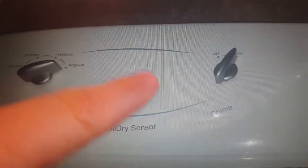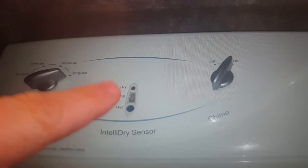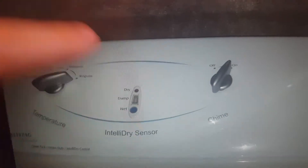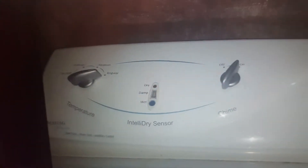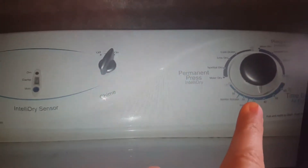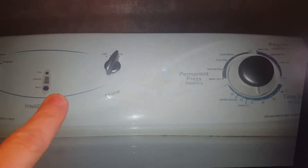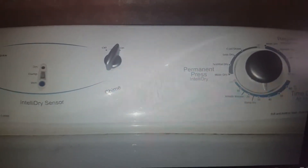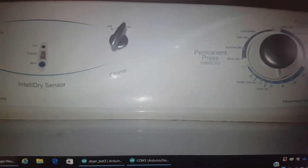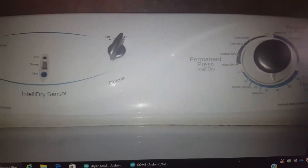The other problem is that the circuit board behind this intelligent dry sensor is blown. I'm going to cut out that circuit but keep some LEDs behind there that still show wet, damp, and dry. The replacement parts for this controller start at $175 — I can probably buy a new dryer for not much more than that — so I started thinking, I wonder if I can build a replacement using a microcontroller.